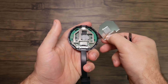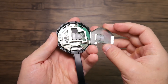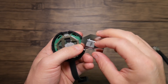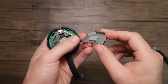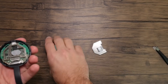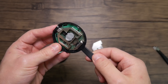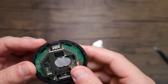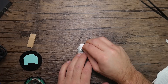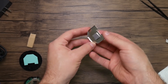After removing the heat spreader, I found they were using a massive amount of thermal compound to make the connection between a tiny little block and the chipset — very odd to see. It screams that they were trying to save as much money as possible. These Chromecast Ultras are only about $60–$70 on their own, so they're not built with a ton of quality in mind. After I cleaned off the compound it basically broke into pieces and I couldn't reuse it — it just wasn't high quality. So I ended up cutting a thermal pad to fit and used that when reassembling.